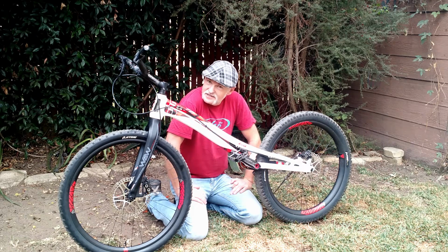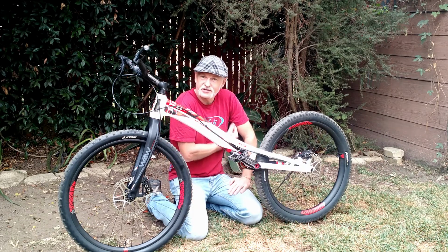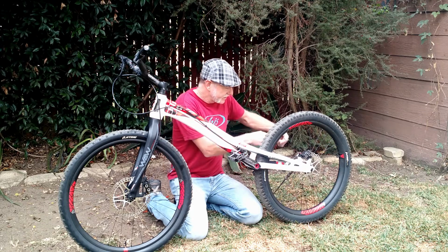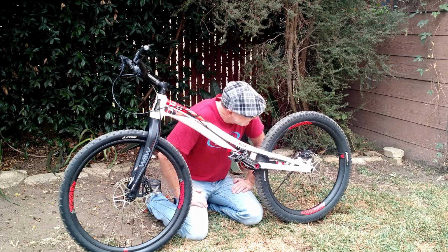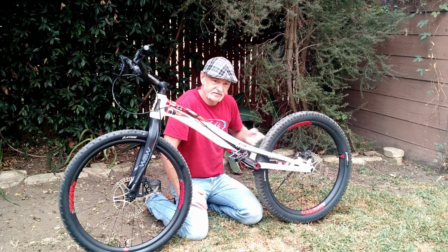I'm looking forward to the next project now, and I understand why a disc brake 26-inch pure trials bike is kind of rare. I don't think it should be as rare. I think they should be more common, because unless you're really riding actual competition, it's still a pretty good option. I'd make it 135 in the rear if I had it all to do over again, and I would make the brakes not incorrect in their alignment. But at the end of the day, it's a lot of fun to ride and gets the job done. And carbon rims, very nice.